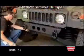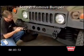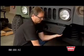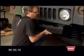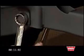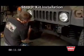The second step in the winch installation process is removing the Humvee's existing front bumper. Using readily available hand tools, remove the shackles and fasteners in preparation for installing the frame extensions. Next, remove the bolts that will hold the frame extensions. Loosen and rotate the stiffening bracket so the frame extensions may be installed. With the stiffening brackets rolled out of the way, you are ready to install the winch kit.